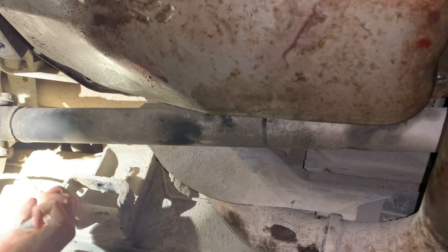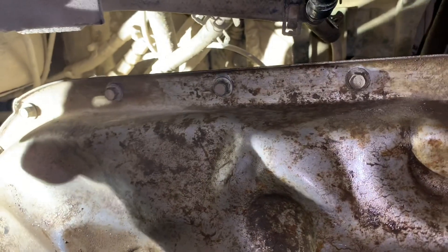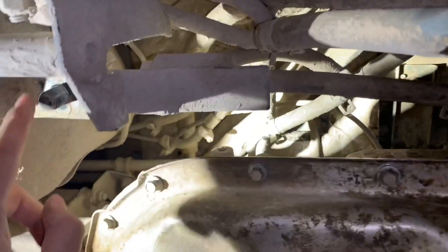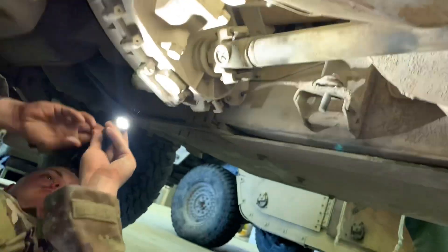When we are lowering the transmission — that doesn't come off, yeah, that's not going to come off. There's another bolt over there, you gotta take that bolt out. We don't have to take that one out though — should we take that one out? This one you could keep in, but we need to — when we put the cross member back up we're just going to use this, put it in hand tight just so it has something to hold on to. The exhaust has to come off too, but I already showed you guys in the video what has to come off — I'm just telling Scott.